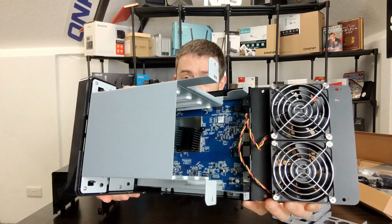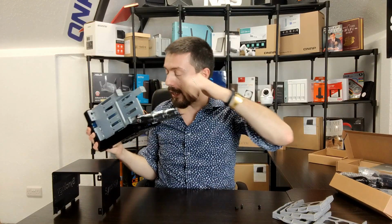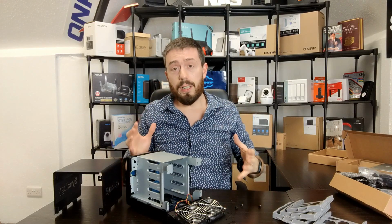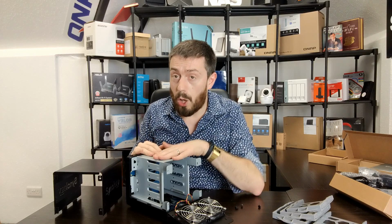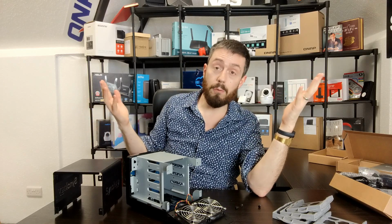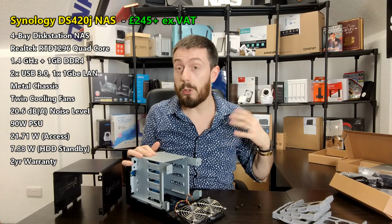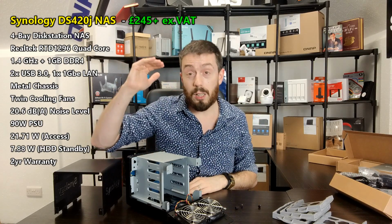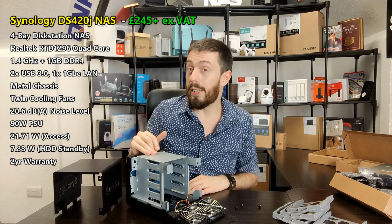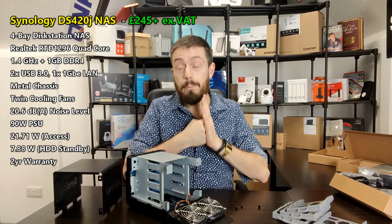And as you can see, the memory is not readily available. It's all covered there with the CPU inside there under that heatsink, but it's still kind of a barren device, and it is certainly aimed at a more cost-effective NAS buyer. But once you've got drives installed in there, like the 14 and the 16 TB Seagate IronWolf drives that I've mentioned before, you're going to have a lot of storage potential, and you do have a good CPU and memory to keep you started. But just be aware that there is a slightly lower glass ceiling than a bunch of other devices, and if you intend to push the boundaries of what this device can do, you will find that those boundaries are not going to move. Okay, so bear that in mind.